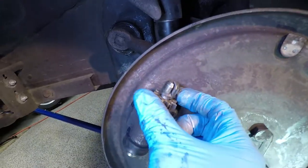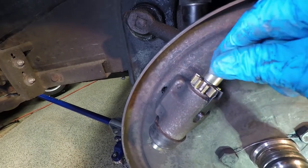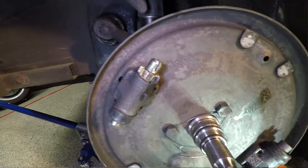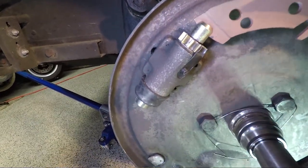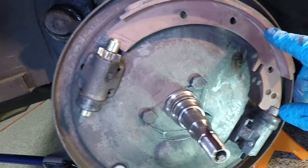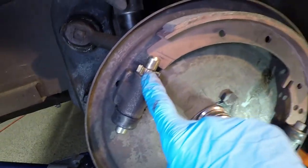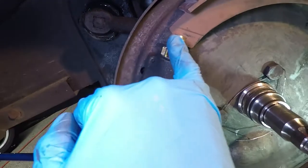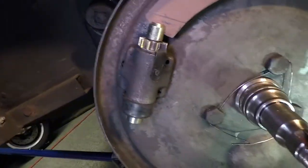One important point about the stars is the slot is a lot deeper on one side than it is on the other. So that's going to fit with our brake pads as they come across. They're going to fit on there properly. Okay, well, I just verified it with the manual, and the stars go opposite side of the notch, and this makes sense now. Look at that cut through this star, see? Plenty of room for it in the bottom.